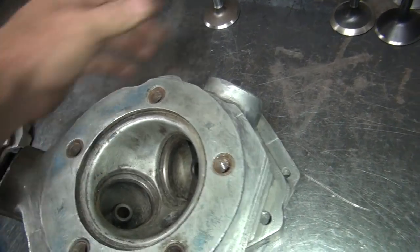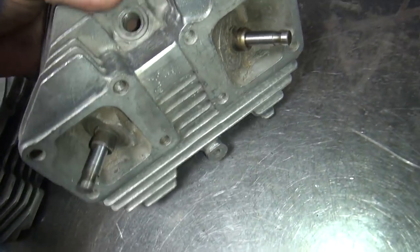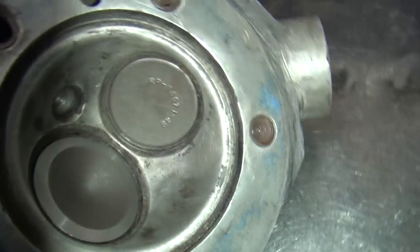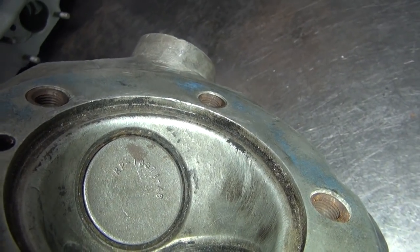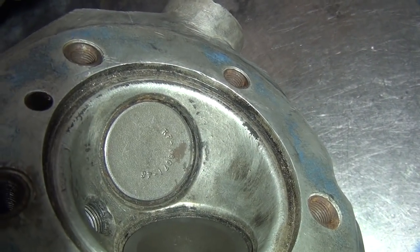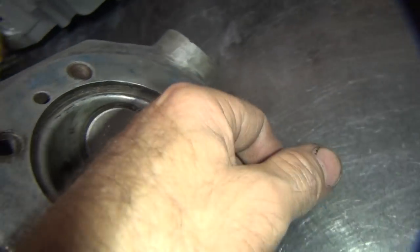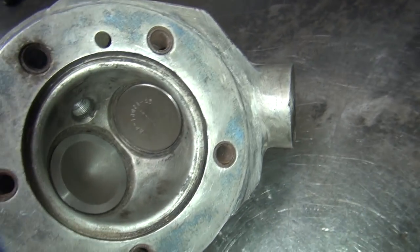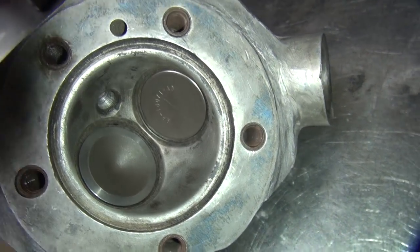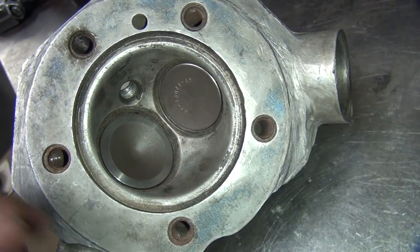It's just a matter of what goes in here. When we say the valves are sunk, that means they're real deep in the holes. So you can see how instead of being way up here like a normal motor, they're sunk down. I think it's done for two reasons: one is because it wears out so it's pretty much useless being worn out, or you do it for high-lift cams because you have a big motor. To get more room for high-lift, you have to sink the valves because the valves will hit each other on the overlap - that's when both valves are open. So you have to drop them down to get clearance. On race bikes you sink these things way down, a lot more than this.